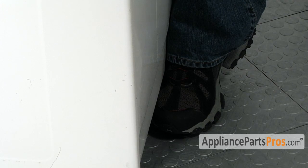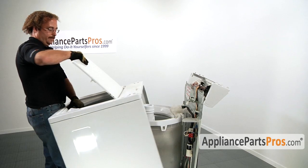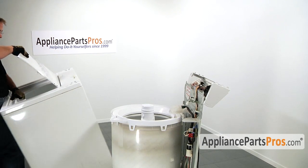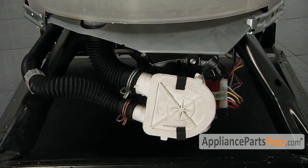So we have to lift up on the lid and grab the body right here. Put your foot against the body of the machine. Tilt the body up to a 45 degree angle and lift it off the machine. With the body off the washer, we now have access to the inside of the machine so we can do our repair.